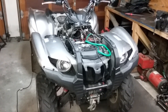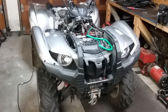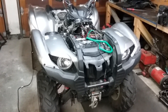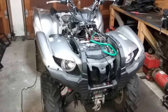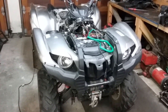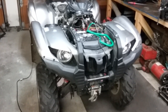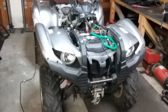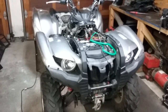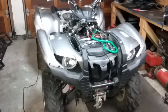This is a video on a Grizzly 700 that is overheating. It's a 2011. Basically what my father said was he was out riding the other day and it overheated. It started burping out some of the coolant and that he heard the fan running once in a while, pretty much intermittently, but basically not working. And that's obviously what caused the overheating issue.